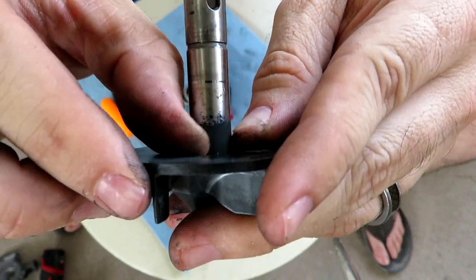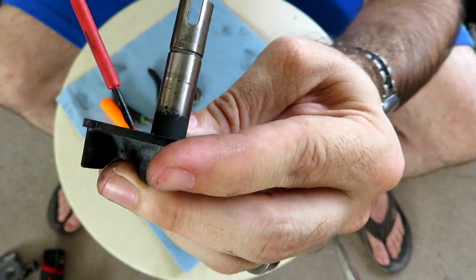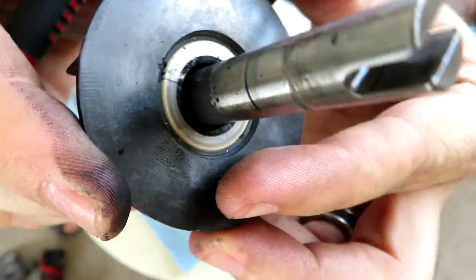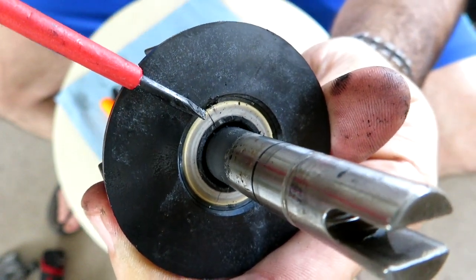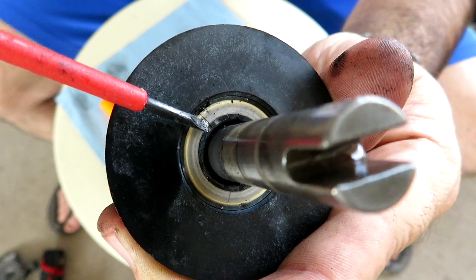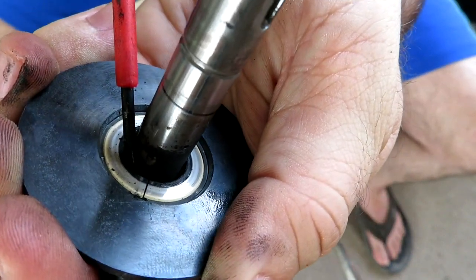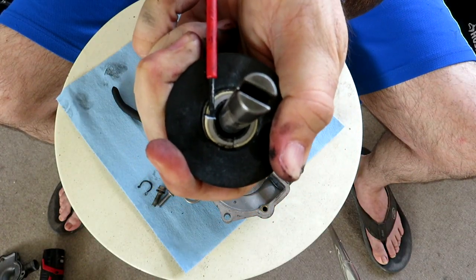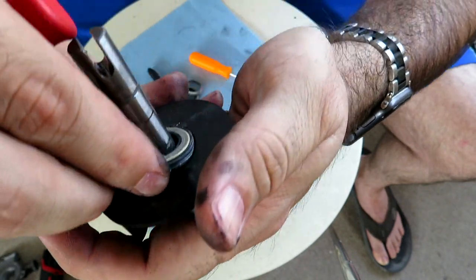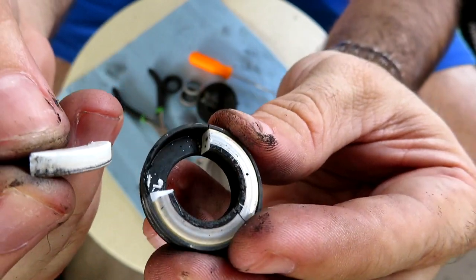Playing with the impeller — I think this might be a plastic or maybe ceramic material. If I can get it out of here — yes, sure enough — there's the failure right there. I'm just now recognizing it. That is precisely what that guy found when he disassembled his unit. When I apply pressure you can see that crack spread. Here she comes — now we find what went wrong. This is the ceramic washer. Well, there's your problem right there.